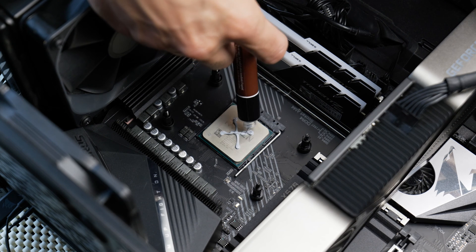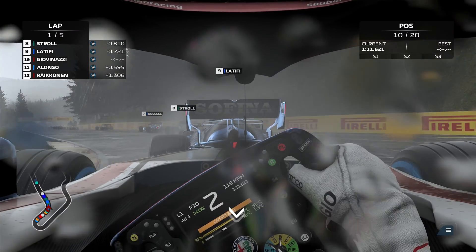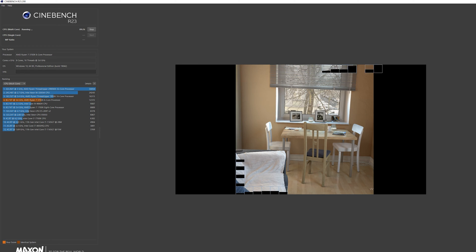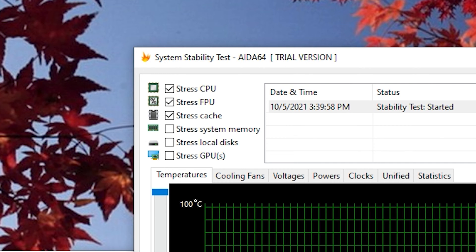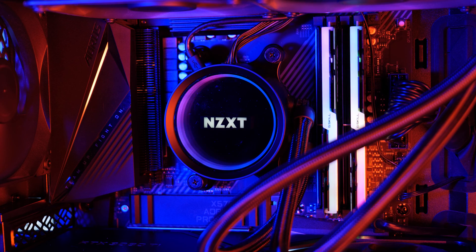It's reasonably fresh, still a mild cheddar at this point. The test procedure: turn the machine on, idle for 10 minutes, then F1 2021 — five laps of Spa in the rain — let the machine idle for five minutes, then Cinebench R23, idle for another five minutes, and finally Aida64 stability test stressing the CPU, FPU, and cache. All temps are taken from HWinfo, CPU CCD1 T-die average reading. The first run is a baseline test, doing nothing to the cooler or the thermal paste, just getting a read on that three-week-old paste — F1 2021 at 49.8°C, Cinebench at 66.2°C, and Aida64 at 72.9°C.